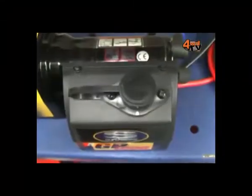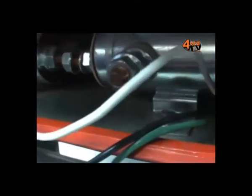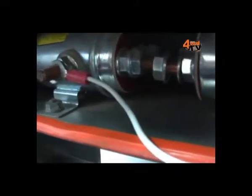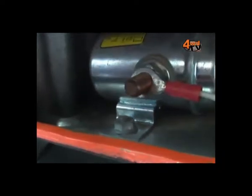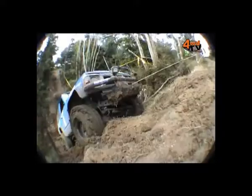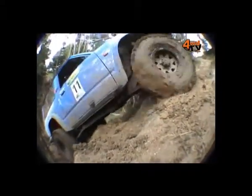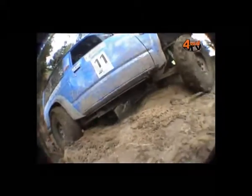So the solenoid is normally that thing we see mounted remotely in that black plastic box? That's exactly right, Simon. And what sort of solenoids are available? Certainly the old school of solenoids is what we like to call the tin can style — they look essentially like a tin can. You'd normally find more than one solenoid within the box; in some cases you might find four solenoids, or a manufacturer may use a double pole, double throw solenoid, so you may see two in the box.